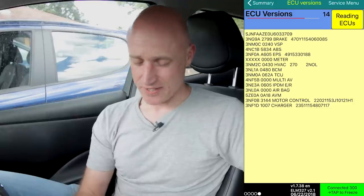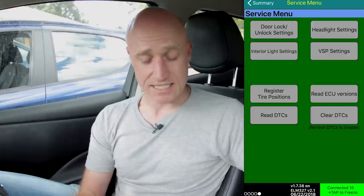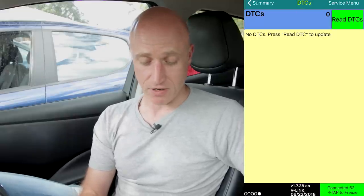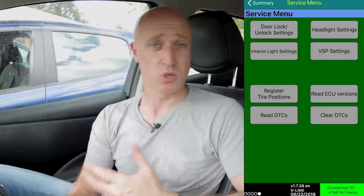Read ECU Versions - I'm not going to go into each individual part of that. If you need to dig into the system that much, you'll probably want to go to a garage, but if you need that information it's there. Read DTCs - Diagnostic Trouble Codes - this is something that is really, really helpful. I've not had any issues with this car, but with previous cars when that warning light comes up, I've had to go to the garage to get them to plug their diagnostics equipment in to read the trouble code. Well, you can do that yourself on this one. Hit Read, and you can see it checks each of the individual components - they're all okay. If any codes came up you can cross-reference them to find out what the matter is. And then if you need to clear them, that will clear any signals left up on your dashboard.